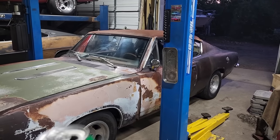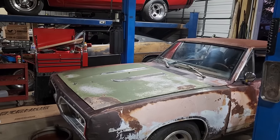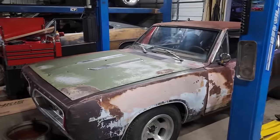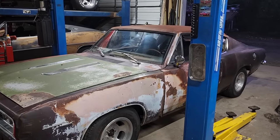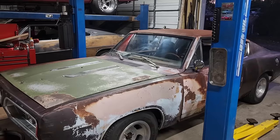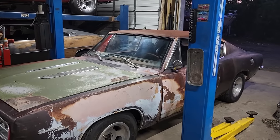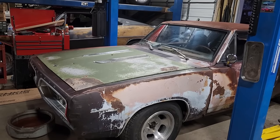Took a little burger break thanks to the neighbors. Now I'm going to torque all the wheels and maybe adjust the alignment on the passenger side arm. Jamie tried to align this at Rocket and couldn't get enough caster on that side, so wanted to make sure the bushings weren't flipped the wrong way, because we did such a good job of putting them in the correct way, obviously. But they were actually right, so that's a problem. Anyway, it pulls to the left now instead of the right, so hopefully we can take some of that out by adjusting that arm. This looks super safe.